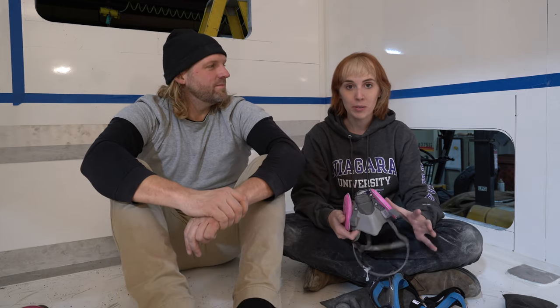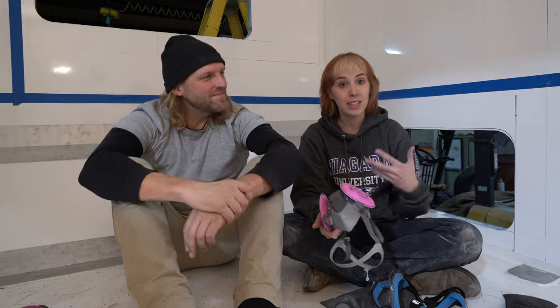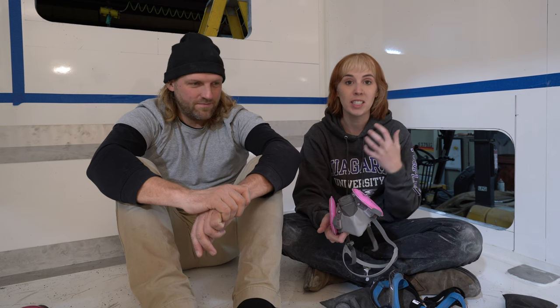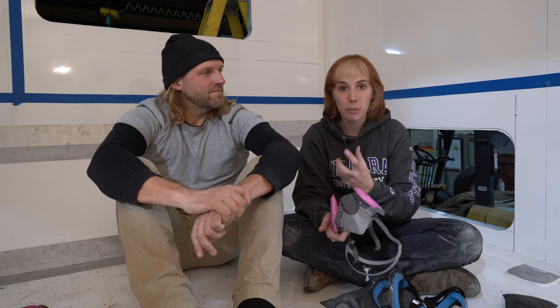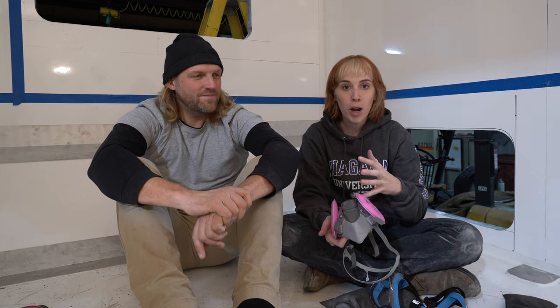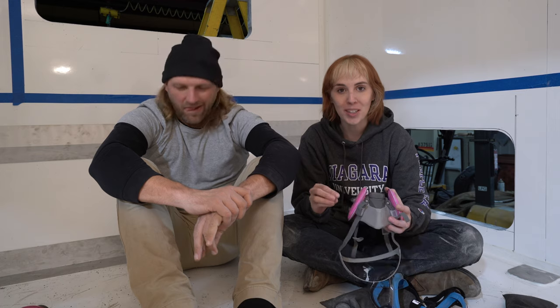So we went to Sherwin-Williams and we told them what we were trying to paint. The inside of a camper. Fine, it's FRP. You can just sand it with a really intense sandpaper grit, like 80 grit. Give it a little bit of tooth so that the primer will adhere and then the paint will adhere. No problem, right? Wrong. There is always a yeah, but.